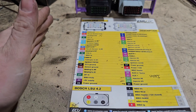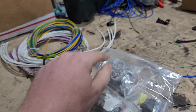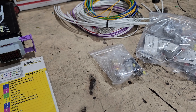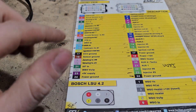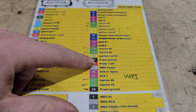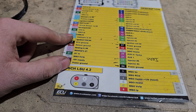Some sensors take 12 volt — like your injectors. They're not sensors but little switches. You want six individual injectors going to the ECU, but the second pin will be 12 volt. Make sure you're planning ahead before throwing your harness together, so you don't realize after you're finished that you don't have 12 volts to the injectors or coils. There's also a power ground — I'll ground the power grounds and ECU ground together to the chassis.